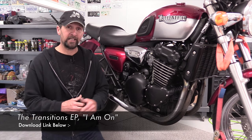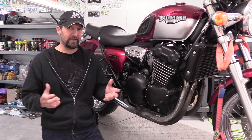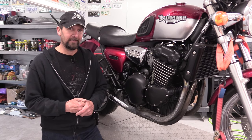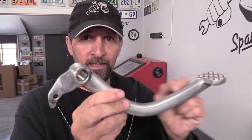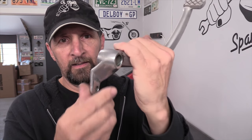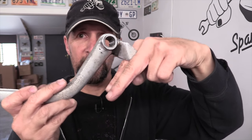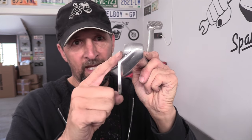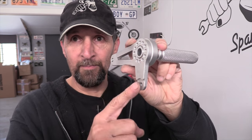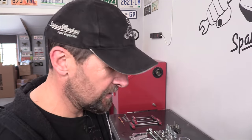I'm going to play a little bit more Transitions music today over the action for you to enjoy. If you really like it, it's free to download - there's a link underneath - and if you want, you could leave the lads a little donation rather than just downloading it for free, and they will really appreciate that. Here's the task for today: that's the big clunky factory lever. All I'm interested in is that bit at the back - that little dog leg, that offset. That's the little lever that goes up into a clevis on the rear brake master cylinder. When you press the brake it actuates it - very simple - but it's offset from the mounting point. I've got to create that dog leg today. My aftermarket one doesn't have one; it's dead straight, so I've got to either make something like that offset or make a spacer to bring the point of contact in by exactly that much.